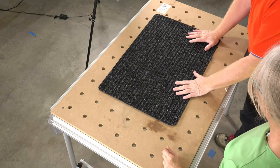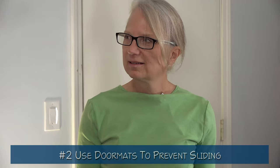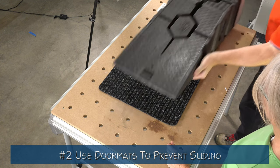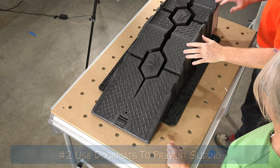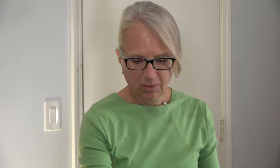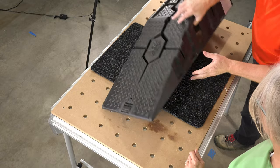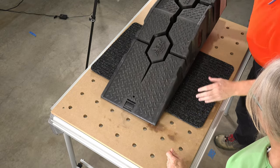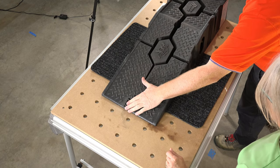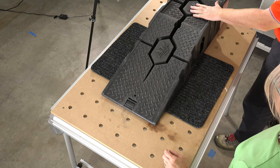That's where these $5 doormats from Home Depot come in. You put the ramp on the doormat and that creates friction. But you don't want to put it so it covers the top of the ramp, because then you're creating friction at the top too, which is bad. Go sideways with the doormat — that way you can place it even while the wheel is there. The rubber part catches the wheel first, then the doormat holds it on the way up. Line the doormat up with the seating line so that when it hits the top, there's no friction and it can slide if it needs to.